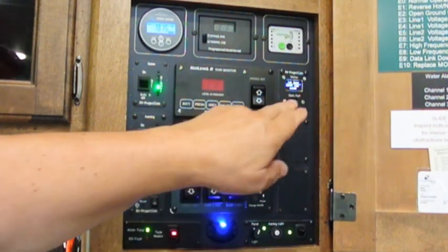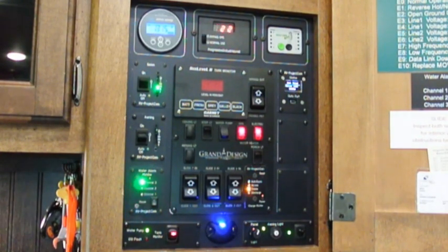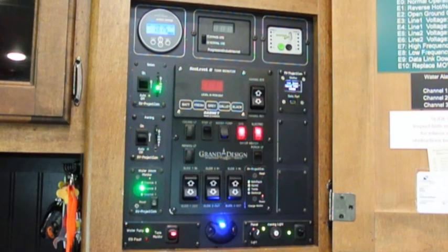And this is a main receiver for my wireless system. Anytime that anybody presses a button on one of the remotes, it's recorded here, and that will kind of tell you if your kids are playing with it. But more importantly, if you're adding a new remote, then it gives you the code that that remote is transmitting, and there is a data port that you plug in with a laptop, and you can actually add the new transmitter to the system. And again, I custom designed and built the whole thing.